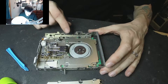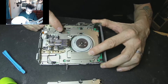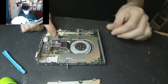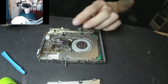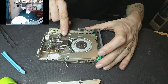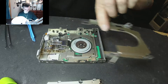Now for this part we have a bit of a problem because there are little pins here that stick out. In order to pull the entire mechanical part out, the eject — this little piece here — if it's not pushed out of the way, it will lock the entire mechanical part. So what you have to do is pull this guy straight out just as if you're inserting the disc, but first remove the spring. Then slide it outward just like if it was going to eject, and voila, that's all there is to it.